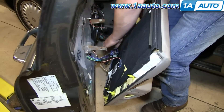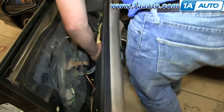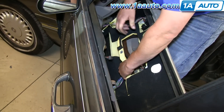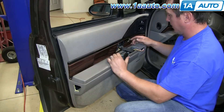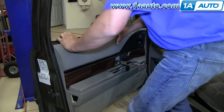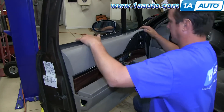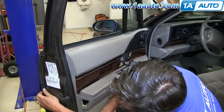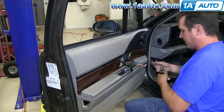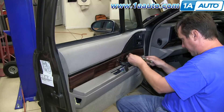Reconnect your connector down here. Keep these up in the appropriate spot. Reconnect your harness up top. Make sure that all five of your connectors are free. Put your panel back up on the sill. Make sure you get it up on the door sill, activate the clips, install the T25 Torx screw, the door handle closeout panel, and that screw.